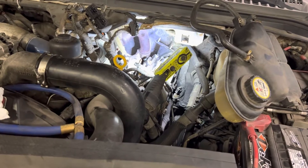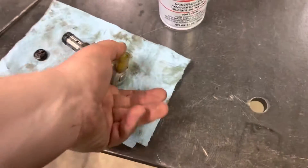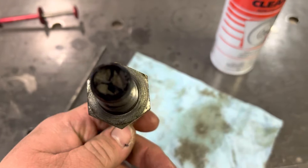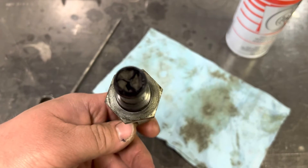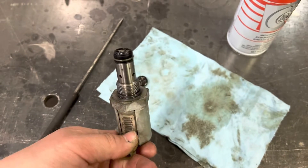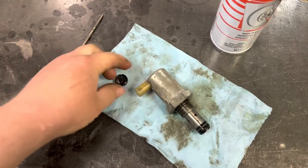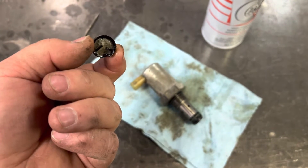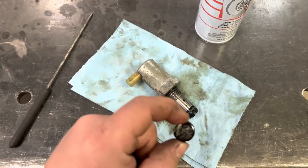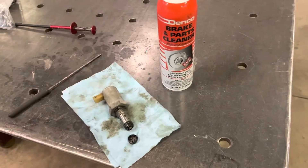I ended up ripping this down real quick and pulling the IPR valve — the new one's in already, but let me show you the old one and my little predicament. I'm actually glad this happened. As you can see, this is the old IPR valve and the screen got sucked down into it, got lodged and stuck. The screen looked a little weird — kind of rounded. I put my scope down there and you can definitely tell this thing is shot. I also found an old IPR valve screen sitting in front of that, so this was double-screened, which is obviously not how it's supposed to go.